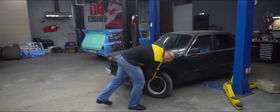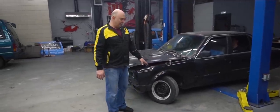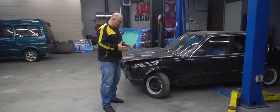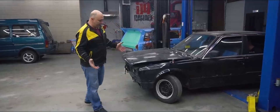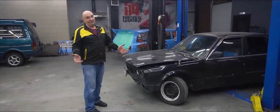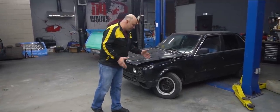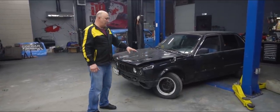But, just like I said, now the frame rail is seriously getting in the way. Meaning we have to bring the wheel out even further. And that would involve even more extending of the control arms. And we're already sitting on the limit. There's really not that much more we can do here. And here's another thing. Turn them the other way, will ya?